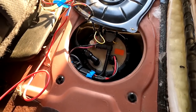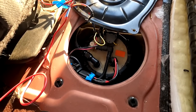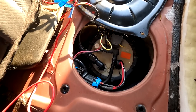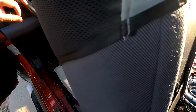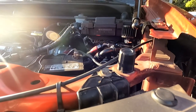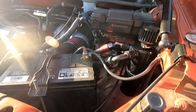Put the camera right at the fuel basket — I'm going to turn the key on and it should turn on. Yeah, it's working! Check for leaks and do it one more time. No leaks. Trying to fire the car real quick. The car is idling. No leaks. We did take note that the car was reading 40 psi on the fuel pressure regulator, then 45 without vacuum. Right now with vacuum on it's sitting at about 53.